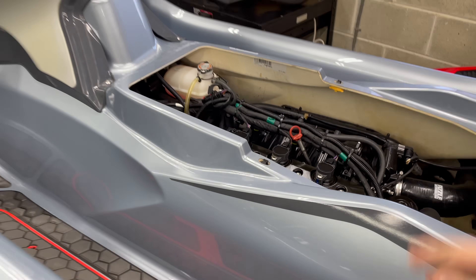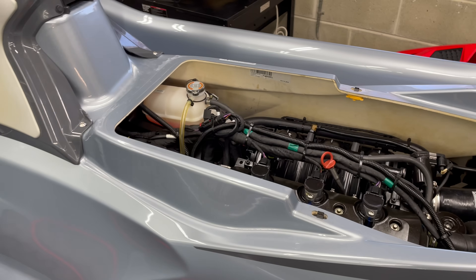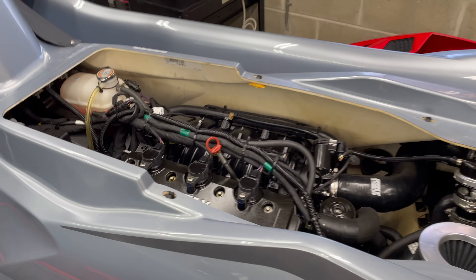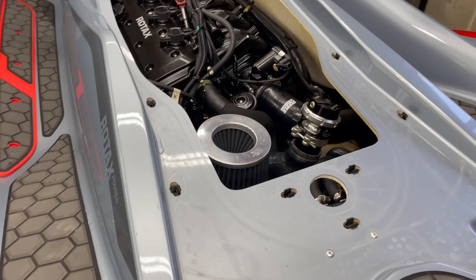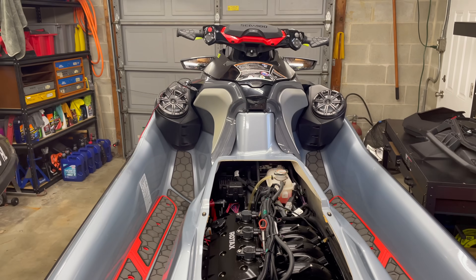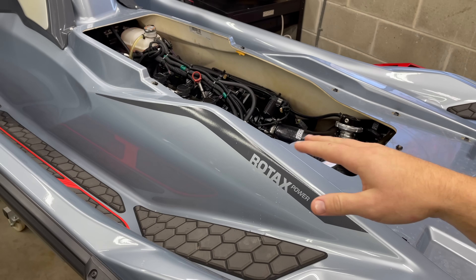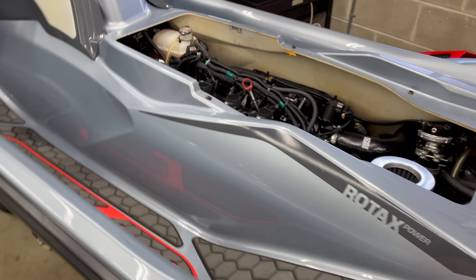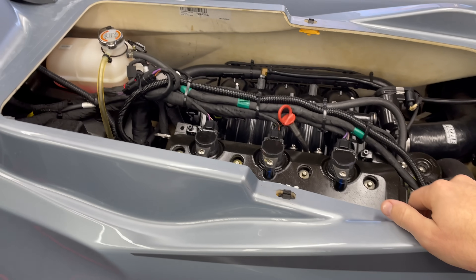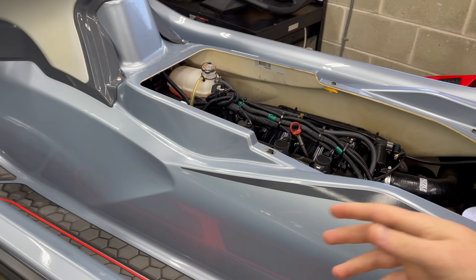This is really something you should be concerned about if you don't ride your ski often. So if you have a ski and you ride it once every few months, it's at a vacation house or whatever — that's probably when you're going to want to get the fuel injectors tested or flow checked. Your fuel system can gum up, you can get debris in the tank. If you ride your ski to basically empty quite often, there's a lot of sediment that can settle at the bottom of your fuel tank, and the lower you ride in terms of fuel, the more likely you are to suck up that debris. So if you meet any of those conditions, you're more likely to see lower flow injectors over time.